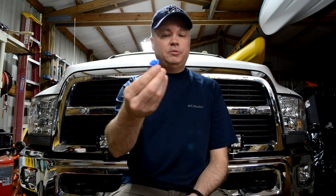Okay, just a quick note with regards to the wiring. You may be tempted to use these crimp style connectors. I've used these before. They're super fast and easy to use, but only in low current situations. These off-road lamps are going to be drawing several amps of current each, so I really think the right solution is to solder the wires.